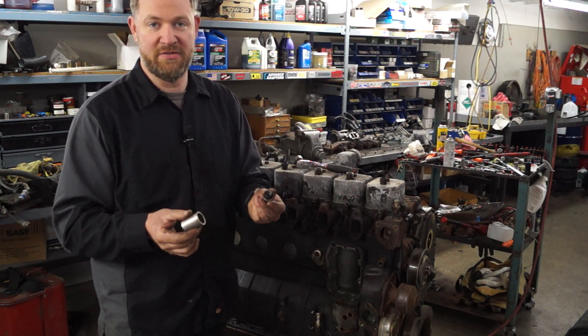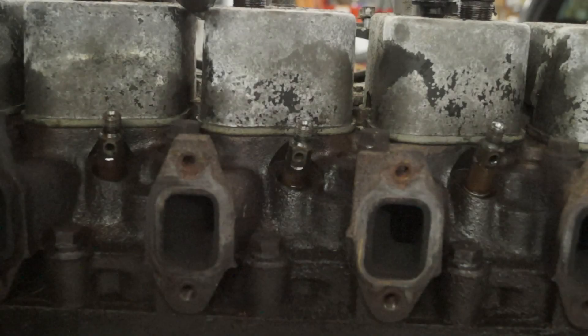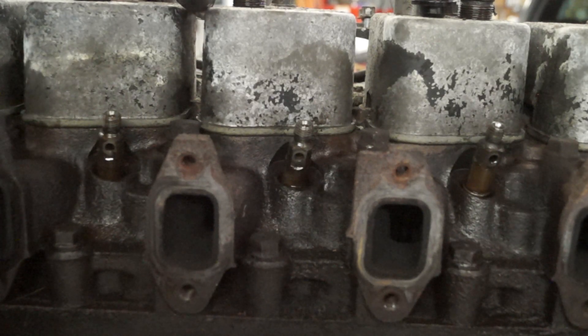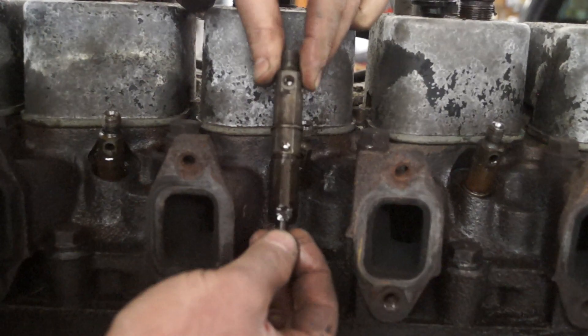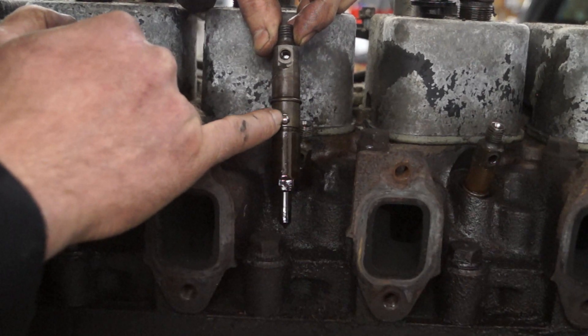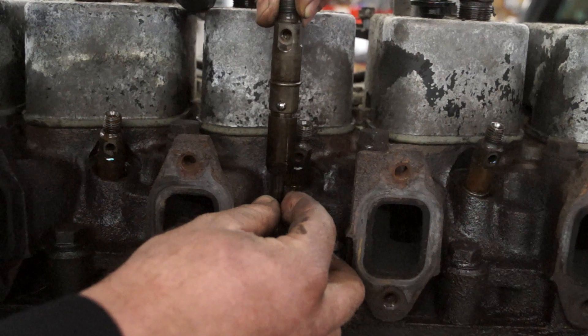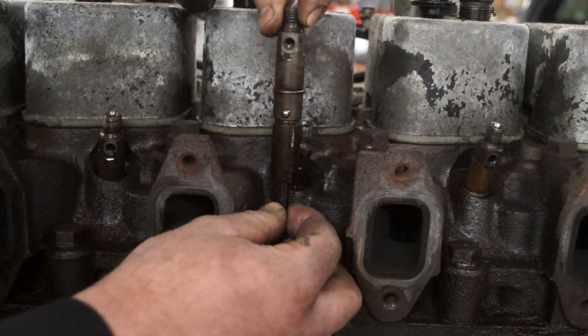This tool is inexpensive enough and it covers both years — I include both sizes. This is what the injector looks like removed. You can see it's got this retaining indexing ball right there which, once it's installed in the cylinder head, prevents the injector from rotating around.